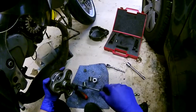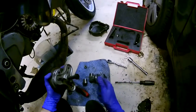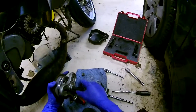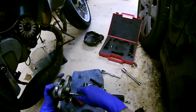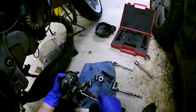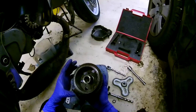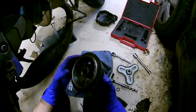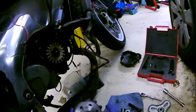While I've got the flywheel off, I'll show you the lightened flywheel for anyone that's interested. I want to keep reiterating that my extractor setup is super ghetto — hopefully you guys have got better flywheel extractors. This flywheel has been lightened and is 80 grams lighter than standard — you do notice it, it's quite noticeable. Prices are in the description if you guys want a flywheel like this.